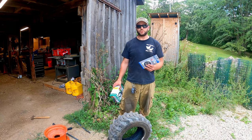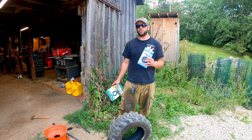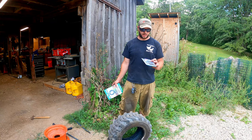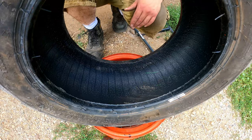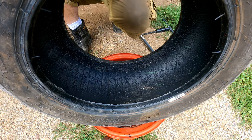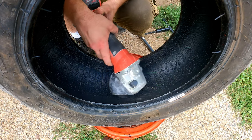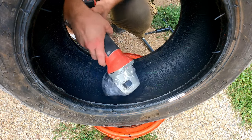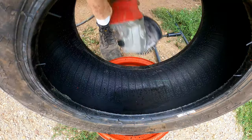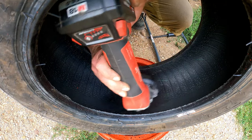I'm not doing a plug because first I'm not a big fan of plugs — I don't think they're as good as a patch — and second, since I ran over a railroad spike it's a pretty good size hole, so I thought the patch would be the better route. First thing we're supposed to do is buff the tire so you have a good surface for the patch to sit on. That particular wire cup wheel on the grinder didn't work the best; I couldn't get in there where I needed to, so I switched to a flat wheel instead and that got in there a lot better.